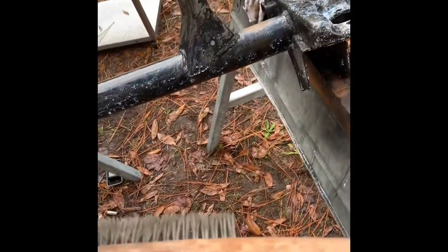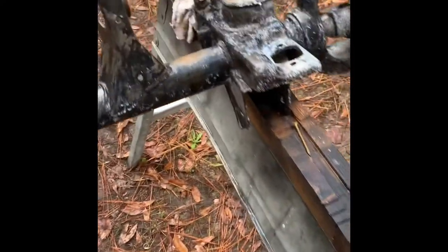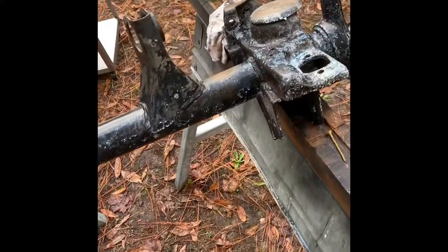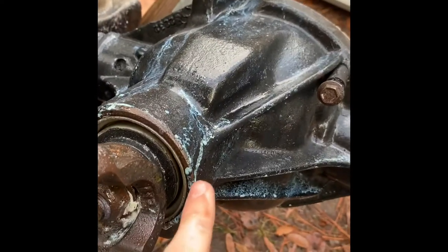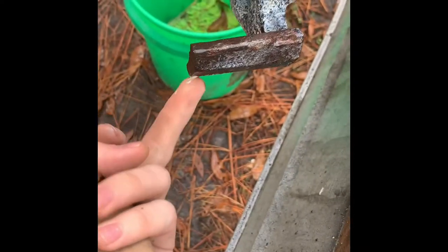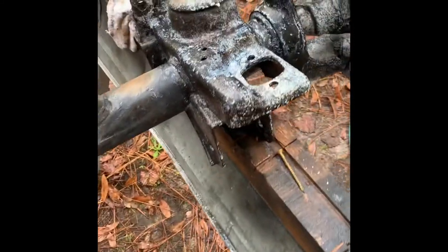We'll hit it with the wire brush. Clean up a few places. Then we're gonna hit it with some black, low gloss farm implement paint. So it's a pretty strong paint. The thing about this stuff is, like we had it flipped around the other way, and you get kind of like little puddles, bubbles, and they come off. It's phosphoric acid. I forget the exact chemical reaction that occurs, but it essentially is not rust anymore.